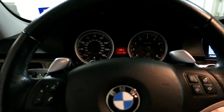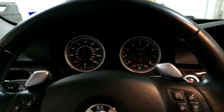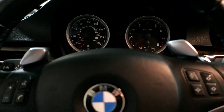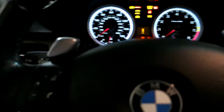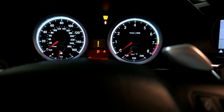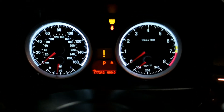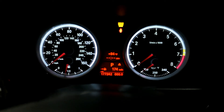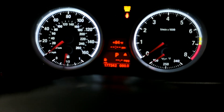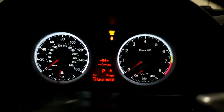My car just flashed and I can already see that even with the headlights in the off position I've got backlighting — that was all it took. That was definitely one of the easier things to code. I didn't even have to cycle the key off or on to get this to happen. We'll go key on and tap over to make sure I still have my vehicle speed readout. The custom coding I did before — vehicle speed — that's still there, and my gauge cluster is lit even with the headlights off.